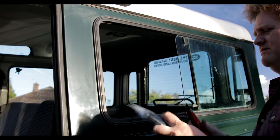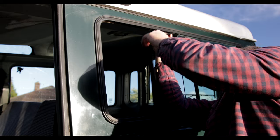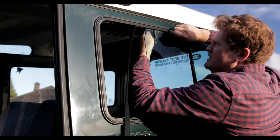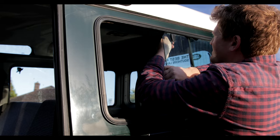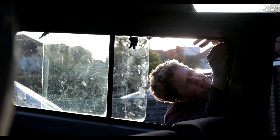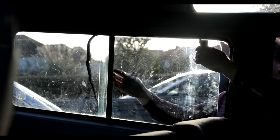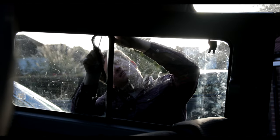It's about $10 per window. What you do is pinch the felt in half and slide it into the channel. Remember to keep the end bit out of the channel — you'll be using this as a tab to pull on. Then slide the window into the new felt section, before holding the felt tab and pulling the felt at the same time as sliding the window backwards. You keep feeding it through like this until the felt fits nicely all around the channel. Once it's in at the front of the window, you can work the rest of the tab backwards into the remaining bits of the channel.